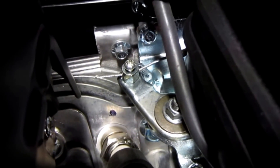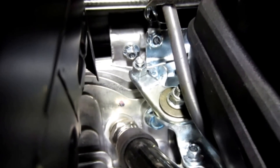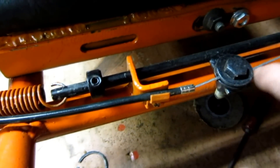Going back to the engine, which this whole review is about — this is slick. From the factory it already had a throttle cable attachment: basically a nut with a hole in it and a screw to pinch the cable. Earlier I mentioned how stiff the throttle was. Well, I made it real loose by taking the friction washer out and placing a regular washer in there instead, which allowed it to move real freely. Then the cable — it's just a brake cable from a 10-speed or something — comes around and connects to the bar.